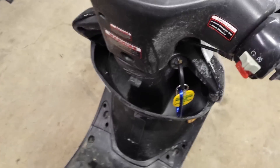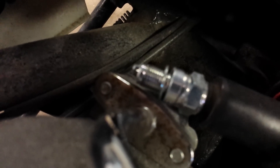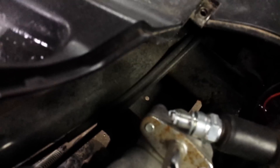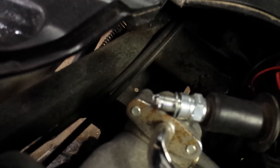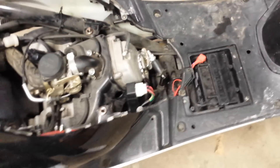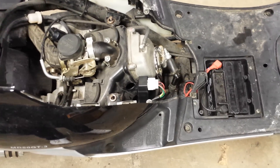I have the spark plug grounded and I'll turn my key on. I have a quick clamp on my brake, you can see the brake is on. I'm going to go ahead and crank it over — there should be spark if the CDI box was the issue. We have spark! So I'm going to go ahead and put this plug back in, start it up, and hope she runs.